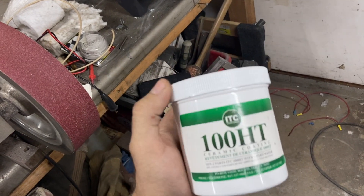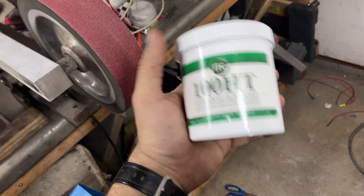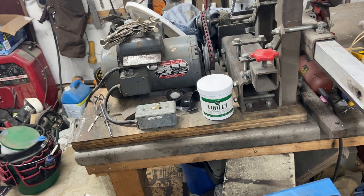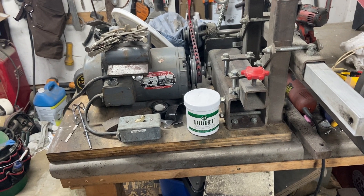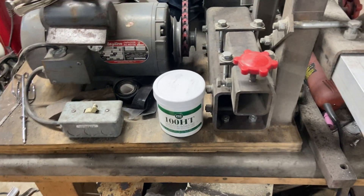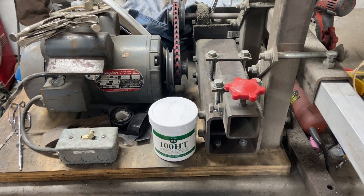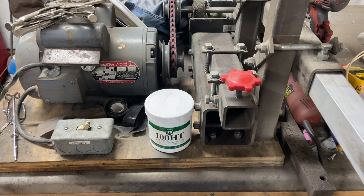Coating the rest of the chamber should at least help, and as you can see, it did. In my opinion it is worth it — it's pricey for what it is, but if you tried to buy all the raw materials separately you could probably make it cheaper. It supposedly contains bentonite clay, aluminum powder, and maybe zirconia or ceramic powder, but nobody really knows for sure except ITC coatings themselves. By the time I went through trial and error trying to make it with nothing to compare it to, I'd have spent well past the $50 they ask for the pint. Go for the tried and true — it's a one-time thing, or at least maybe once every few years.